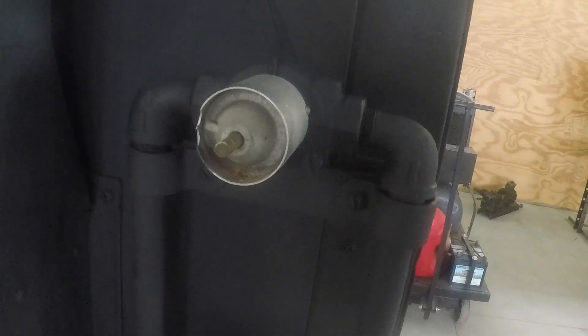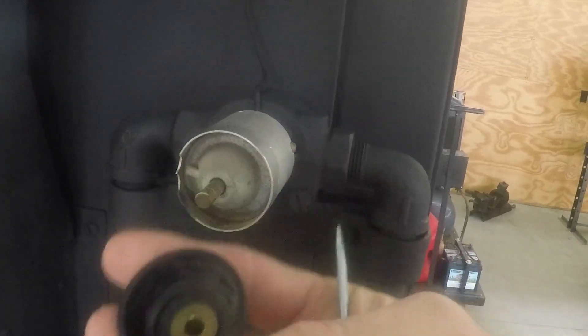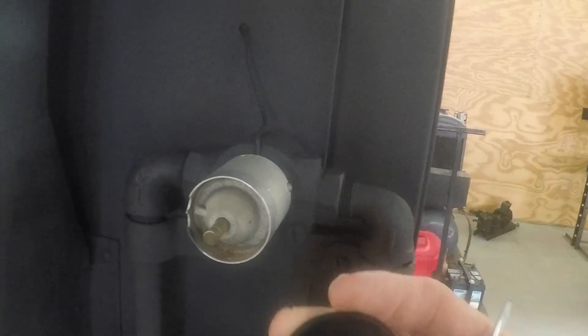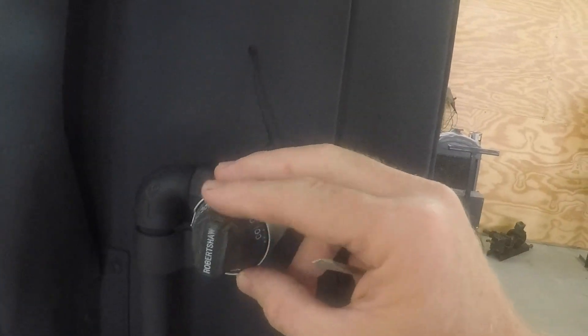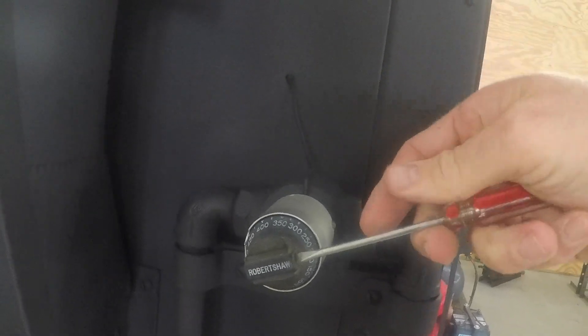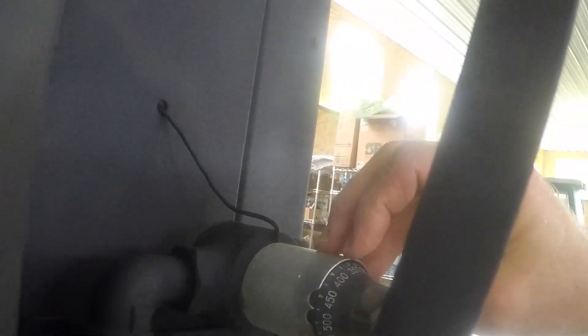There's a neat thing with this knob. You've got this stake here that's the stop for the knob, and you can see this little hump on the inside of the knob — that's what stops there. Otherwise there's just a set screw on here. So you can put this anywhere you want and set it so that the numbers on this thing will match up with the little arrow on the side here. So even though this is different gas, I should be able to turn that and at least get one set temperature right that's going to match up to my thermometer.